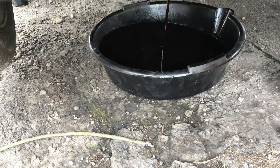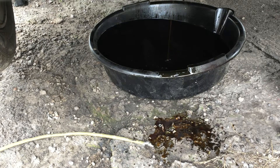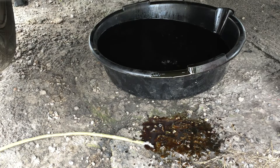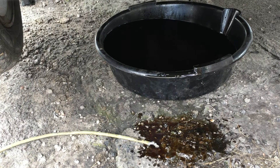I've actually changed the fluid once before, about two years ago, and it's a good idea to change it every two years or every 27,000 miles, whichever comes first. When draining the oil it came out almost like water — very thin and it didn't smell particularly oil-like. I suspect that's due to short journeys over the winter, meaning there was quite a bit of petrol in the sump.